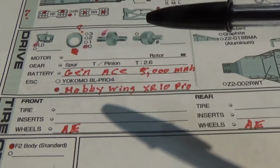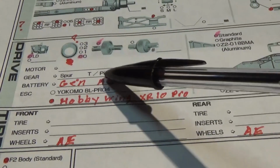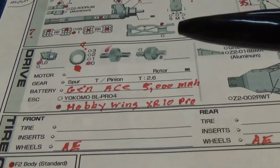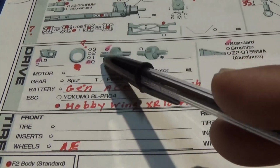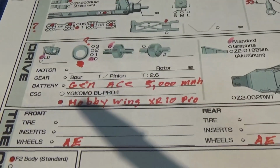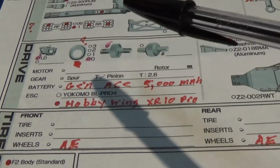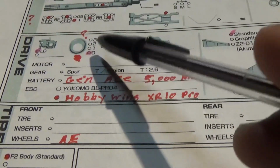Another thing I did back in the back is I lowered my transmission down to 0. And that's another thing I play with, 0 and 1. I'm very new to the diff height or outdrive height. From my understanding, if on carpet or whatever, you're running on like 1 or 2, just to make the back end pivot more, like just make it rotate more. And that's what I was trying not to do. Like I said, my truck felt like it was on ice on initial drive, so I dropped my diff down to 0.